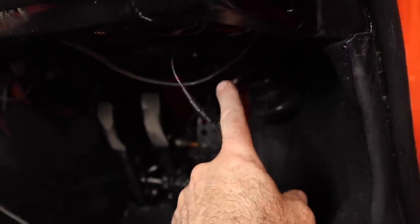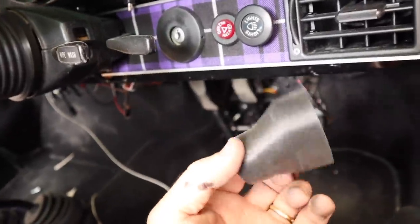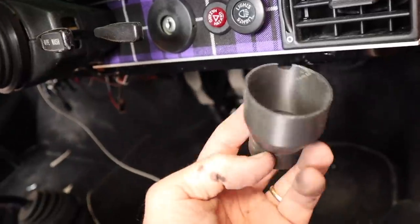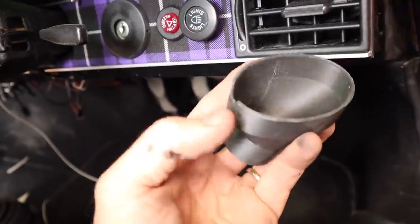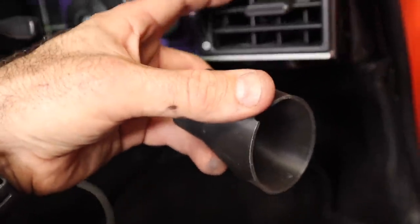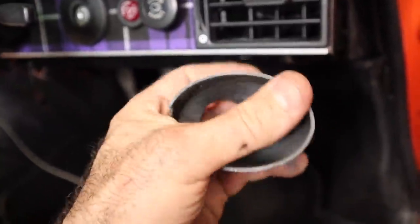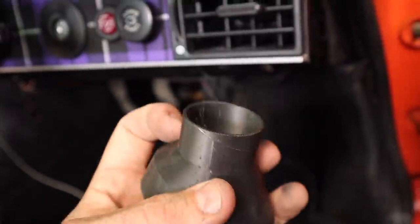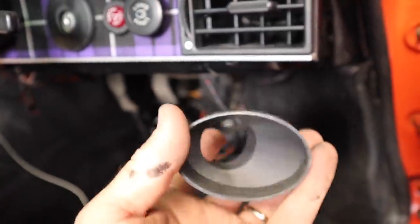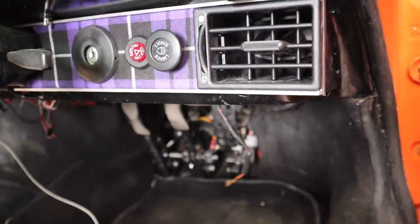And while we're talking about it, on the vent side of things, to attach these through to the 40 millimeter tubes inside, I got onto my trusty 3D printer again, and I designed and made these simple little ducts. Those little notches there are to get around one of the little shapes in the back of the vent. So this shape is perfectly sized for the 964 vent, and then it just converts down to this duct on a slight angle, and that will make it nice and easy to plumb it all together.